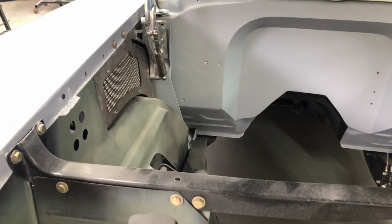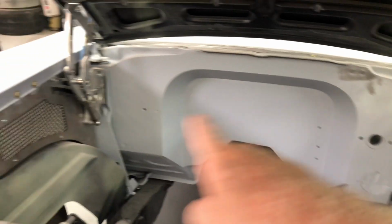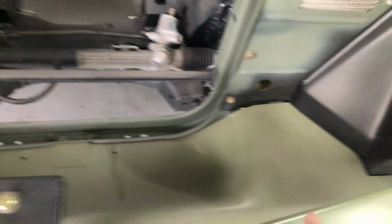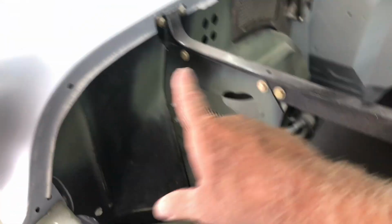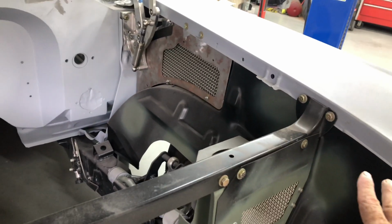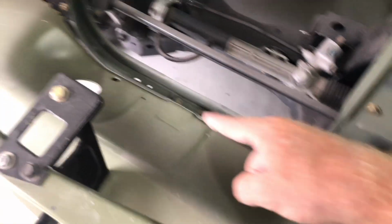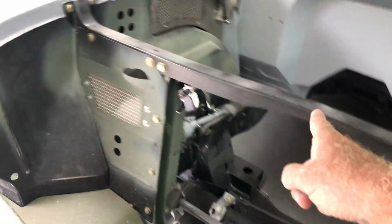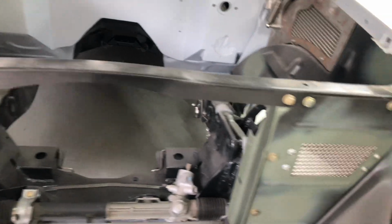So, engine bay. I'm gonna paint the firewall. We're gonna paint the underneath of that black. It'll be like a hot rod black. Same with the inner fenders. All the inner fenders, they'll be all hot rod black. I think this is gonna go body color or shiny black. Factory, that would have been like a satin black. The firewall would have been body color. The inner fenders were like a satin black. And this front tray area here, that was a shiny black. And this was a satin black as well, the radiator support panel.